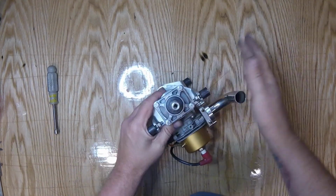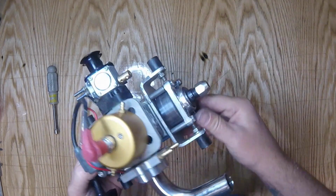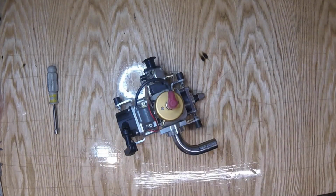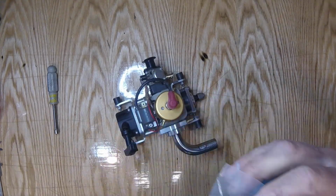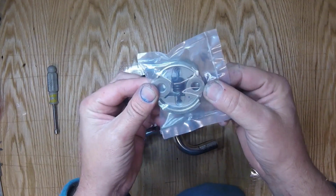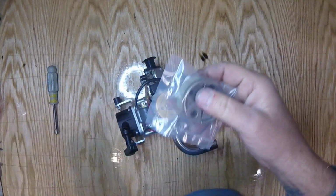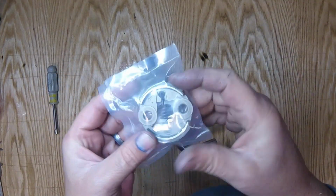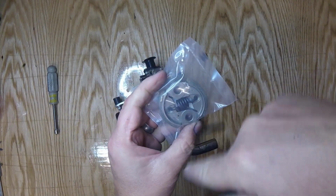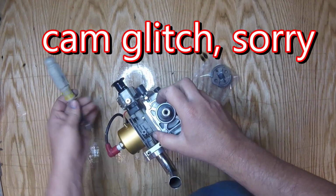So anyhow, you've got a few parts to this, right? What the clutch is, it's a centrifugal clutch, shoe clutch. Now, hang on a minute. I was fixing my cousin's kid's scooter the other day, and I ordered a new clutch for it. But this is the same clutch that comes in RC gas cars, 5th scale, like my big gas car up there. It's a spring shoe clutch, okay? So when it's spinning around on the crank of the engine, boat clutches are different.